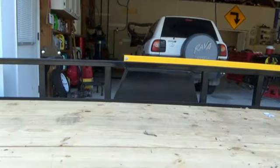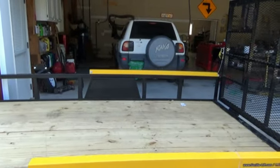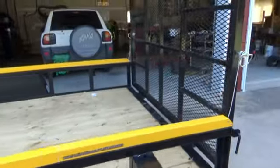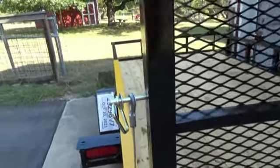This is a Salvation trailer made in Waco. Because the trailer is made to allow the gate to fold down into the trailer, I used these pins so that I can pull a cotter pin, pull the pin, and that way nothing will be protruding here. It will allow the gate to fall down into the trailer when I want to fold it down, because these gates are like sails going down the road. So that's my solution to still being able to close the gate down into the trailer when I'm not using it.